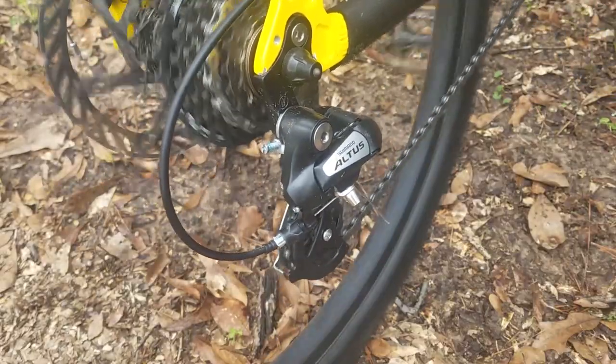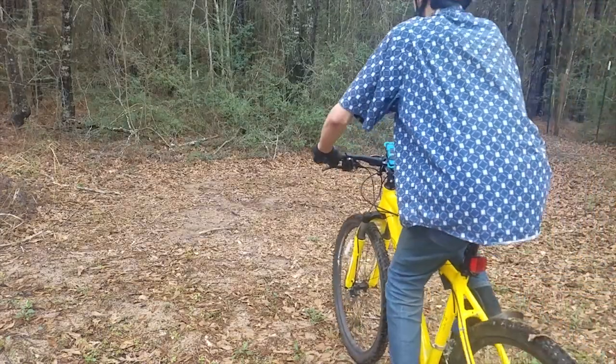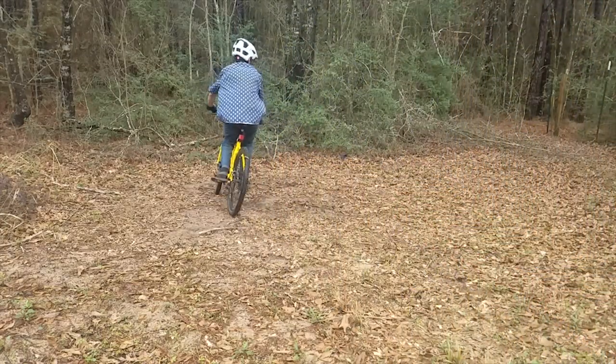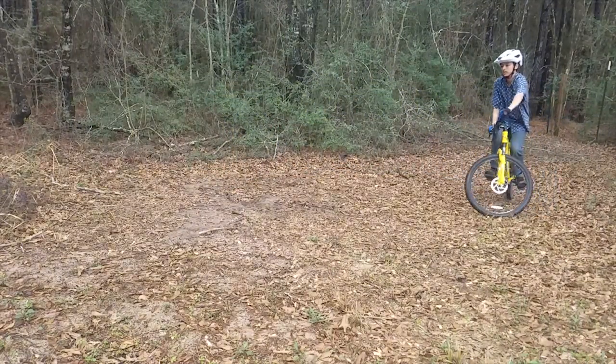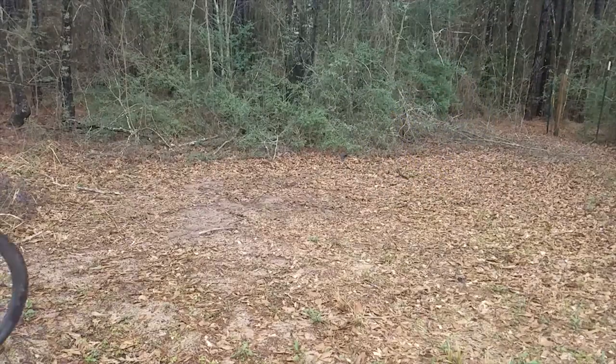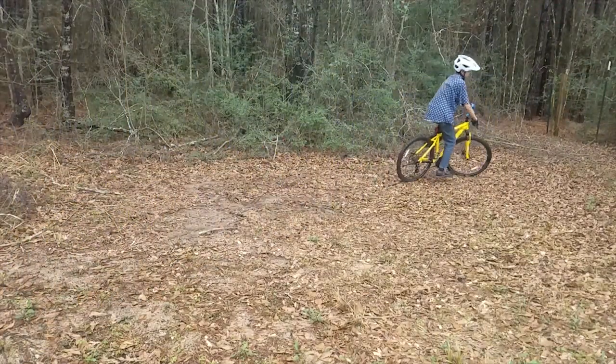I'm the kind of person who actually uses my bike — I don't just pedal it. I broke the Shimano Tourney RDX TX35 just by a simple fall. Not only did the derailleur break, but my hanger bent too because it was a pretty cheap one. After that the derailleur did not shift correctly anymore, and the fall was just on mud.